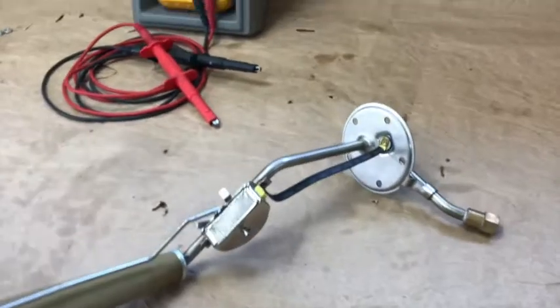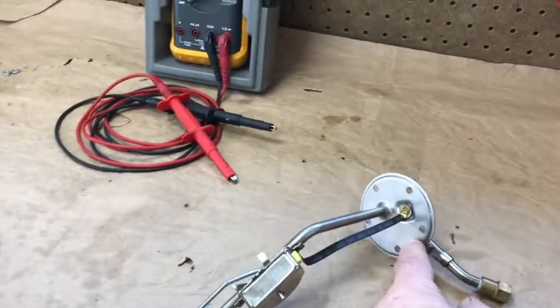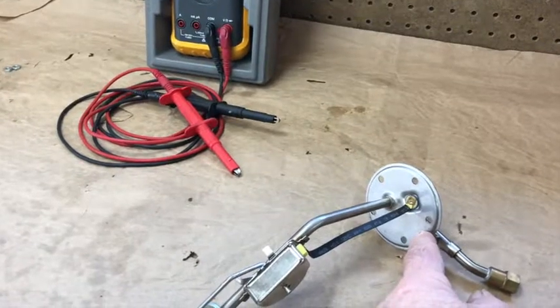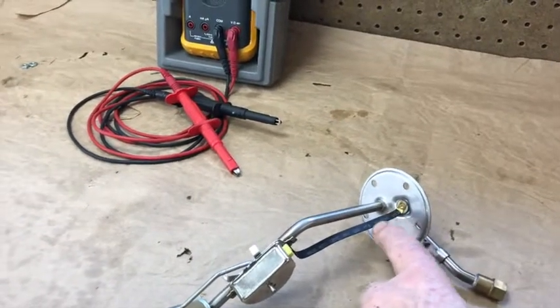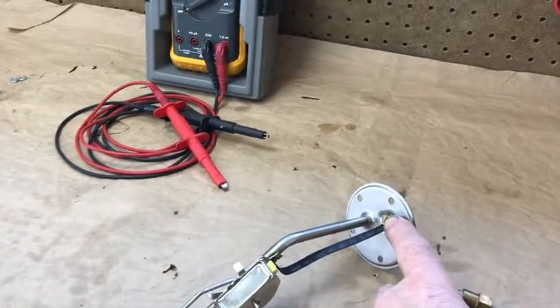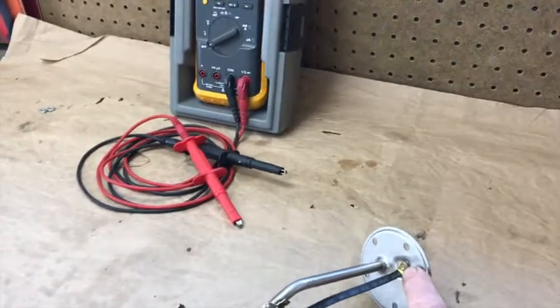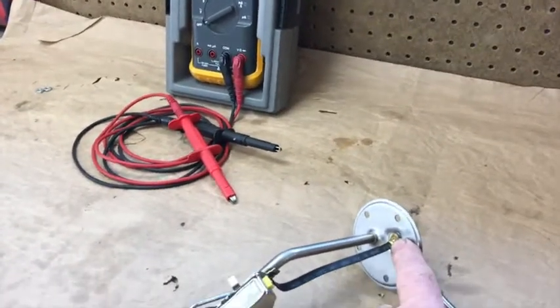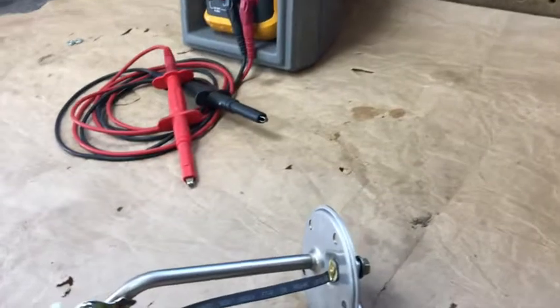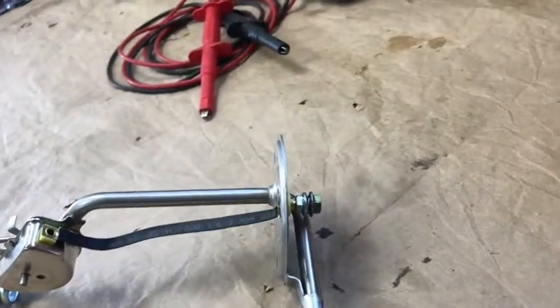This is how this thing is built. There's this piece — this is like the bulkhead piece that goes on the outside of the tank. There's this little brass strap that goes from the terminal that you attach the wire, which goes to the conductor that goes to the fuel gauge. You attach on the opposite side of this — see that stud sticking out there with the two nuts on it.